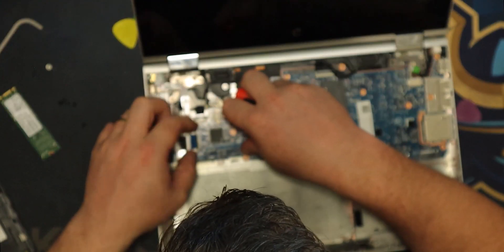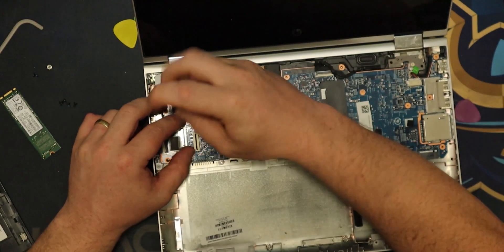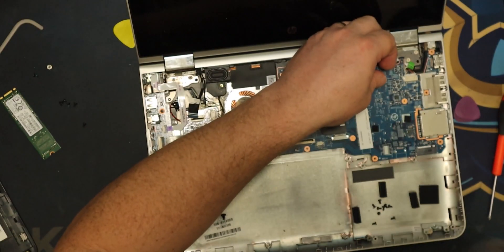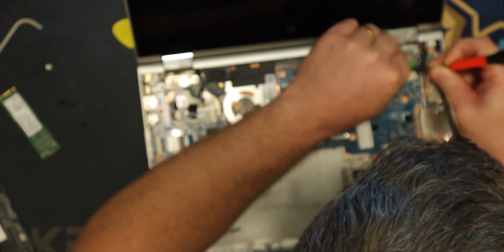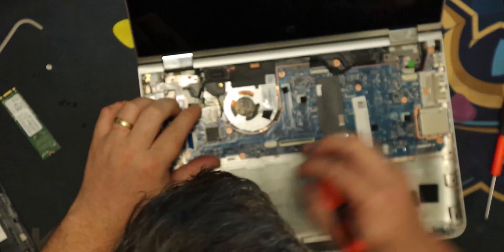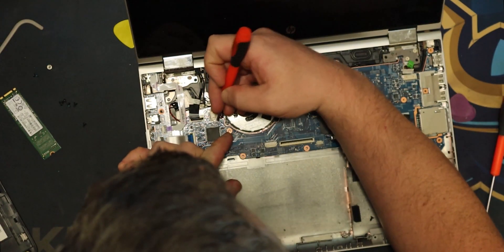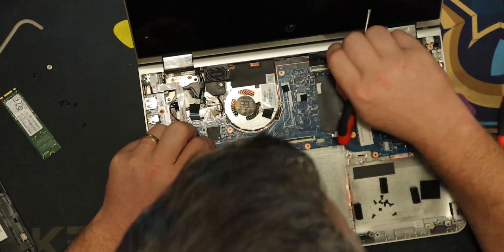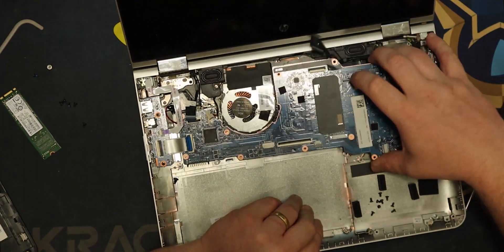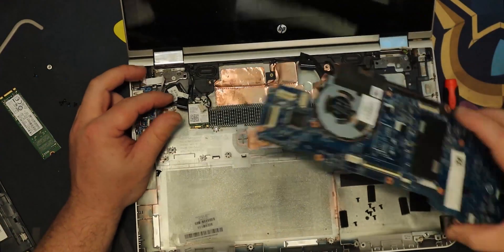I do apologise — my head kept getting in the shot and things kept going out of focus, so I trimmed some of that footage. There is one screw hidden behind a ribbon; make sure you get that ribbon up because it's hiding that screw. The last two plugs are solid plastic plugs, whereas all the rest are ribbons. I used a screwdriver and a fingernail to unpick those carefully without scratching the motherboard. These motherboards are fairly flexible, so be careful — there's a lot of weight on them when you lift them up, and you don't want to flip them around too much or you may snap them somewhere in the middle.